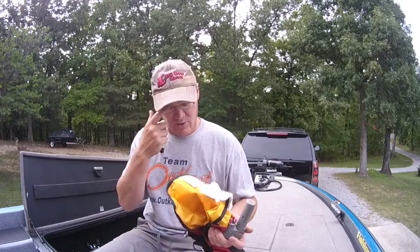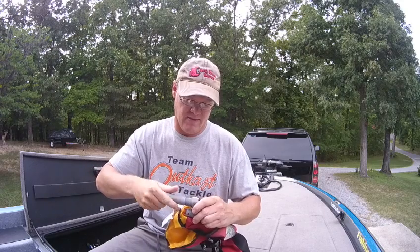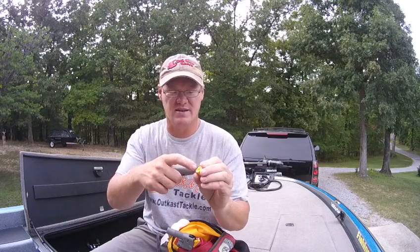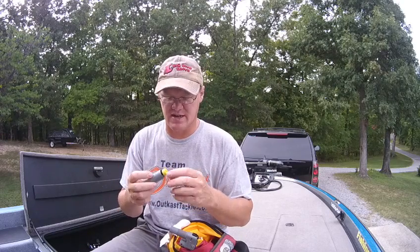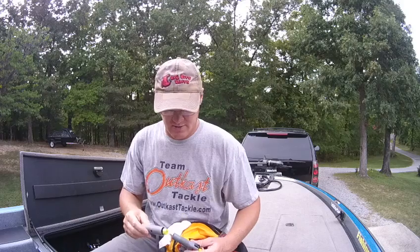But just a reminder, guys, just check these out. Check that bobbin again. It's pretty simple. You got it right here. You just screw this out of here, pull it out, and there it is. There's only one way to put it on. They always say white side up, and it pushes on there. Don't force it on. If you got it going the wrong way, you're going to break these little nipples in here, and then it's no good anyhow. But a $10 part can save you 50-60 bucks. Kind of a no-brainer. Save your life too, in fact.